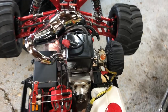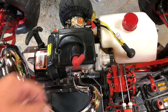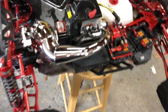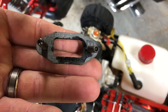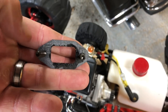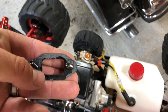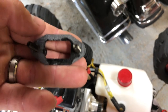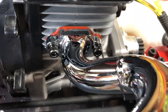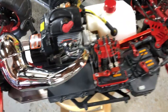If you go with this pipe, you are going to have to take a Dremel and dremel out the inside of the flange. The way I did that is I took an exhaust gasket, put the bolts through it and through the flange, then took a marker and traced out the inside of the exhaust gasket onto the flange — because this gasket is almost port-matched for the motor perfectly. Use it as a template when you're dremeling the flange. Then seal it up with high-temp silicone for a good seal.